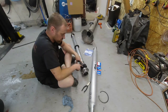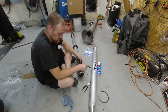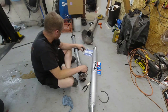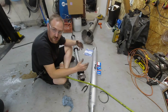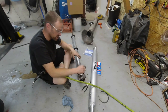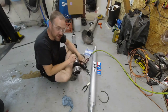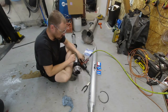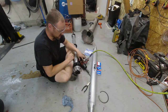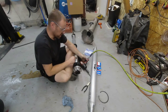We have to remove bolts, but technically we only need to pull the ones that go to the flange, because that flange goes directly to the drive shaft. There are three on each side that need to be pulled out. Those bolts are usually extremely tight and have Loctite on them. Even this 1,100 foot-pound impact gun struggles — my electric impact rated for 1,100 foot-pounds doesn't even come close usually, so I went straight to the air impact at almost 150 psi.